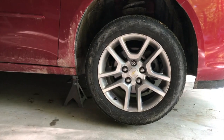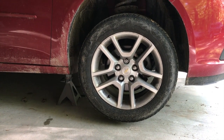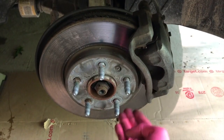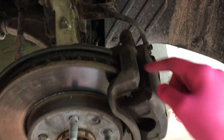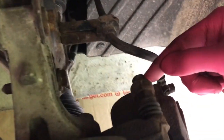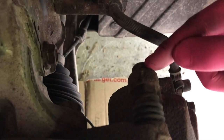At this point the vehicle is resting on the jack stand. Now we are going to remove all the lug nuts and the tire. Tire is removed. From here we grabbed our 14-millimeter socket and ratchet — with better access to the actual rotor, caliper, and the brace that houses your brake pads. The 14-millimeter bolt goes into your actual caliper slide. We are going to remove that, as well as an additional 14-millimeter bolt down at the bottom.